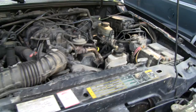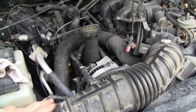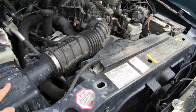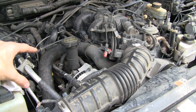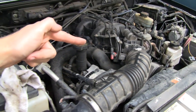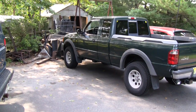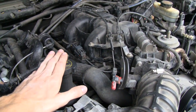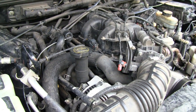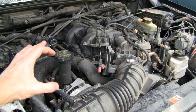On my particular application — a Ford Ranger with a 4.0 single overhead cam motor, also found in Explorers and Mustangs — they have plastic guides and tensioners that don't really function all that well. For a split second when you start up these engines, there's basically no tension on the chain. There's supposed to be a spring that holds tension, but those springs just don't really work too well. I've got a truck with 170,000 miles that had a cold start rattle when I got it at 130,000 miles. And this truck I'm working on now has 40,000 miles and it rattles on cold starts. It's just a bad design, and if you want your engine to last, these pre-oilers are the solution.